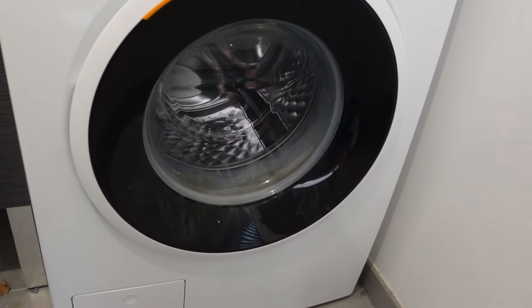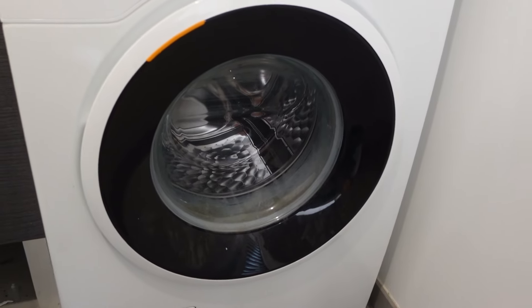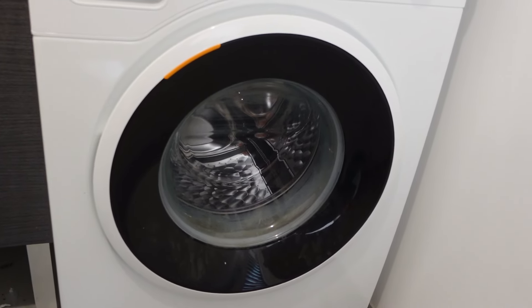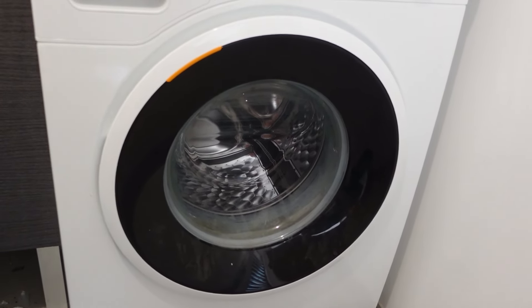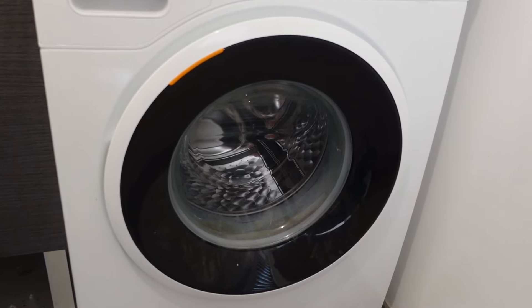Open and close the door six times. By opening and closing six times, this will signal to the washing machine to do a restart. Depending on the model this can vary a little bit — it can be anywhere between 6 and 12 openings — so if it doesn't work after 6, try again increasing the number up to 12 openings and closings of the door to reset it. Thanks a lot for watching, have a great day.